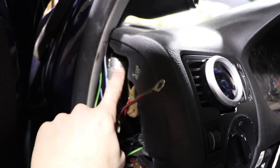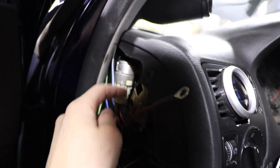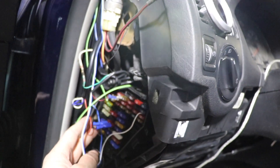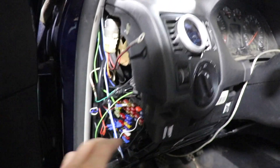Got this relay mounted — I made a little aluminum bracket, basically a C-shape with a bolt in the back going into the steel. We're waiting on a terminal block to put next to that, and then we can put all this wiring to the terminal block and everything will be super nice and neat and not ready to catch on fire.